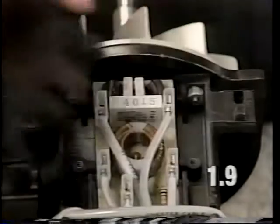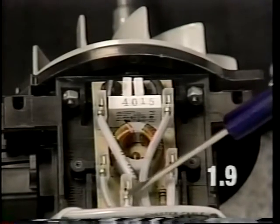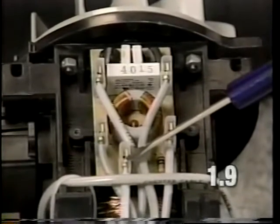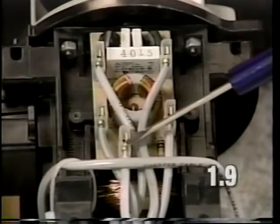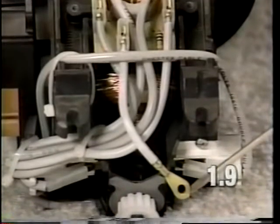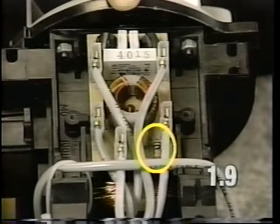The 5-wire EMI wires up the same as a 4-wire EMI, with the exception of the static discharge wire. The static discharge wire plugs into the back of the EMI board, and the eyelet of the static discharge wire attaches to the left rear motor mount screw. The two resistors located on the lower right corner of the circuit board are intended to help eliminate static electricity from the outside surfaces of the cleaner.